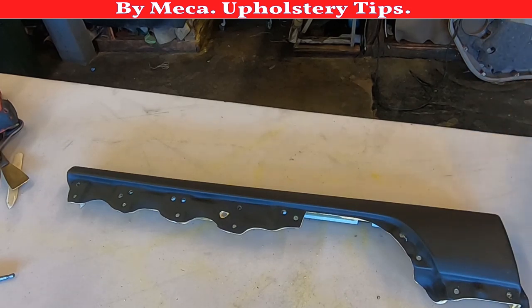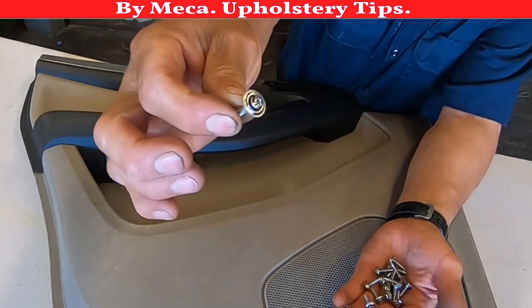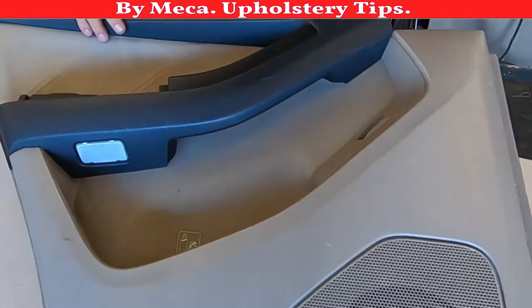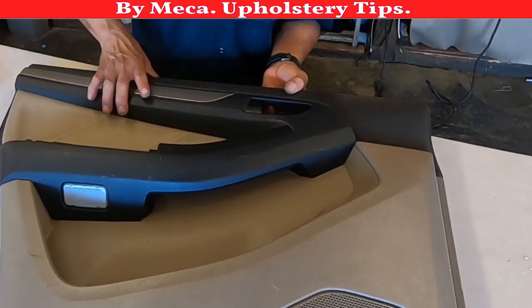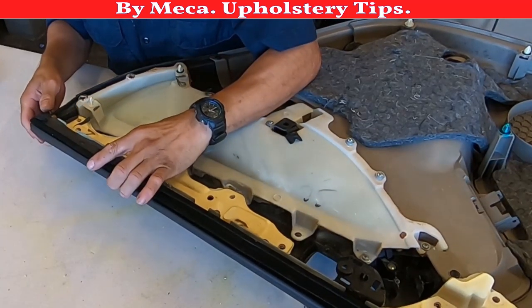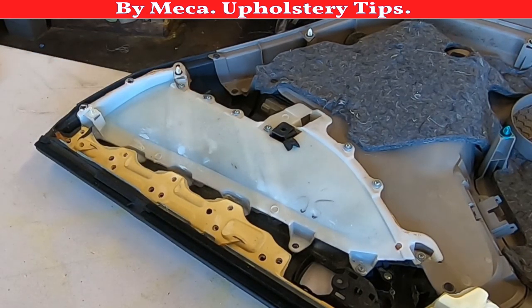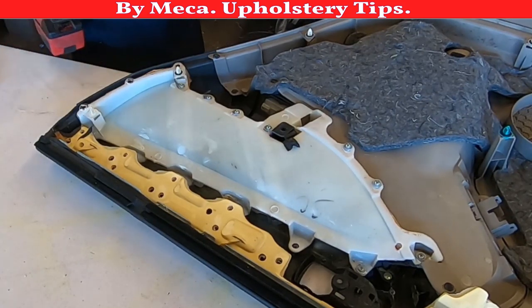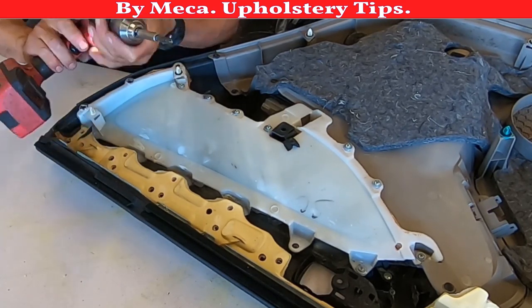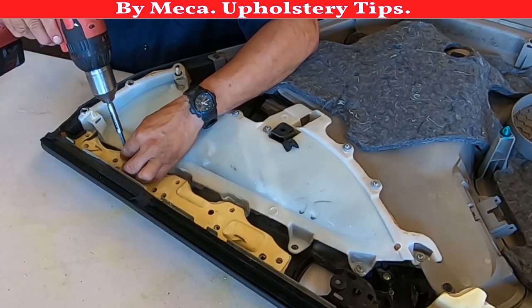Now it is time to assemble. I have half-inch number six screws with washers. Those screw drives are number six half-inch — half-inch is too long. If you use those half-inch screws they will go all the way through the door panel and you'll see them from outside, and you don't want that. You have to cut them before you use them. It has some screws on the bottom and some clips on the tab, but now it will all be screws because I cut those clips. I regulated the power of the screw gun so I don't ruin it.